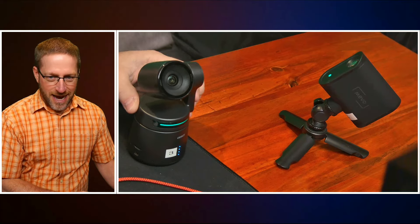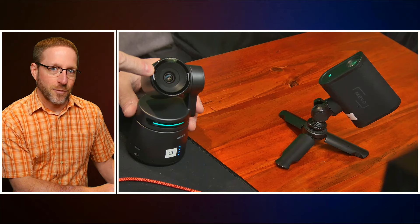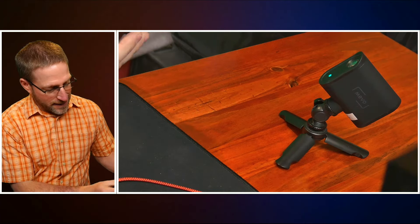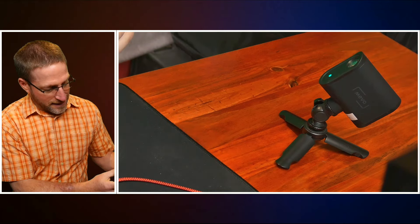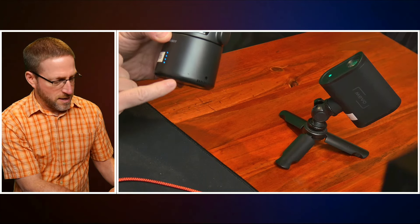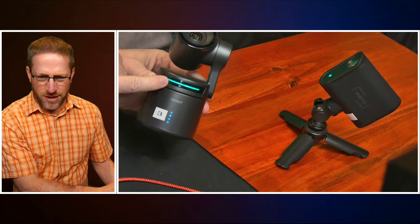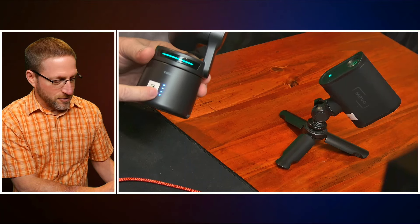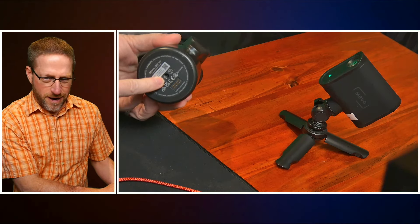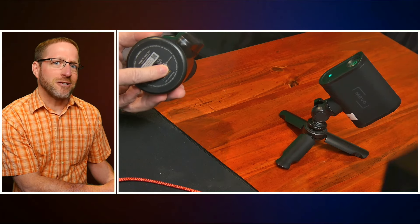The ObsBot Tail Air has a tilt, swivel, and tilt lens — it's a PTZ, but with a fixed focal length. There's no optical zoom; you zoom by cropping in on the image. On one side is an audio input, there are two microphones on the front, a USB-C on the back. As the camera moves around it can get sound from more than one direction. There's a tally light that looks turquoise on camera but is actually green. Three blue lights indicate battery strength. On the bottom there's a 1/4-inch thread and pins for an additional battery and 360-degree swivel base.